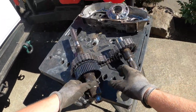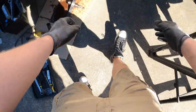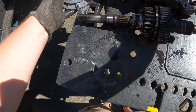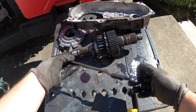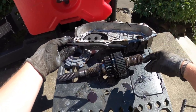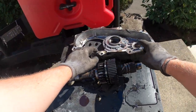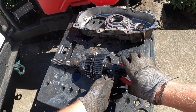It's pretty much six parts. We have the rear output shaft — this is what we need to be changing out right now, so set that down on some cardboard. We've got the rear output shaft, which has some dirt from removal. You have your oil pump and your oil spout right here. There's some previous RTV hanging out there, so I'll note that you want to make sure you've got an O-ring in there. Let's concentrate on this and use the snap ring pliers.